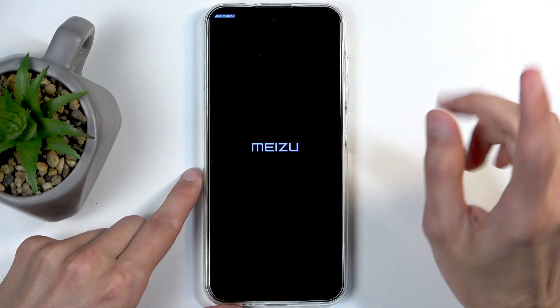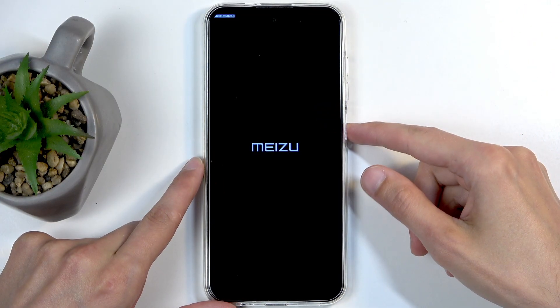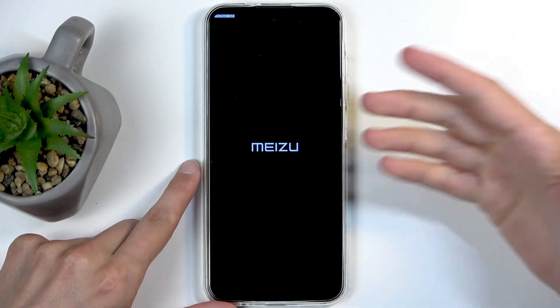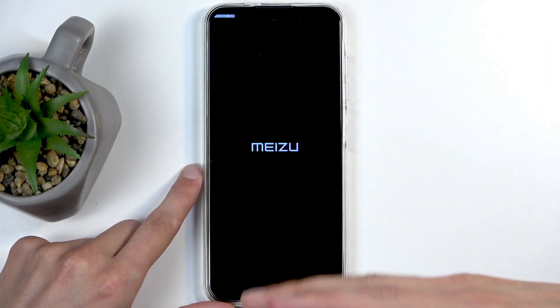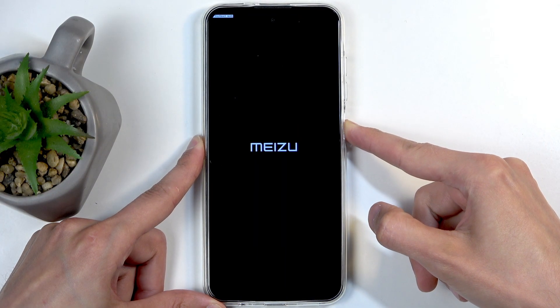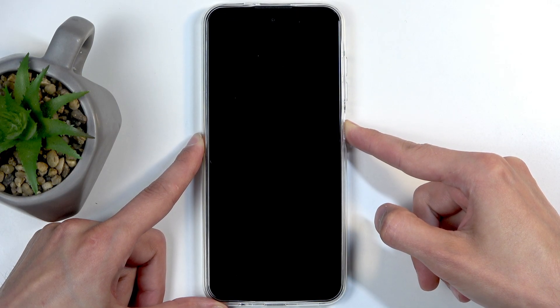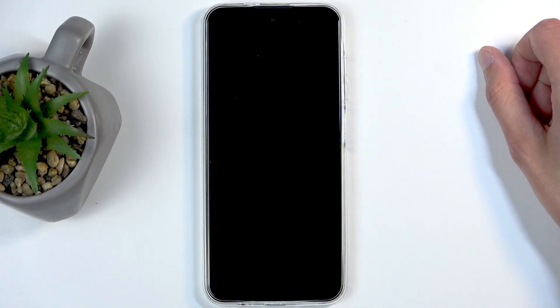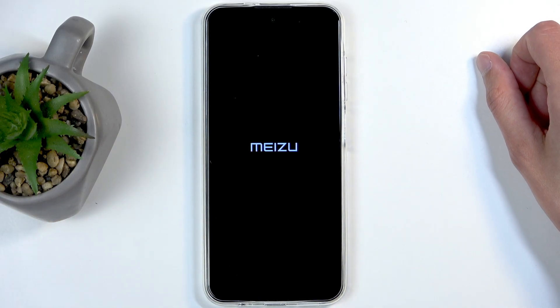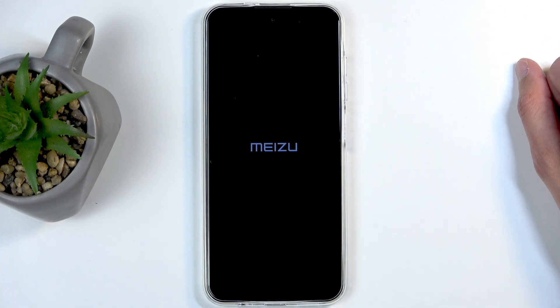I also want to point out there is no recovery mode, if you're wondering. Now to leave this mode, you can either use an application — because it's usually what you use fastboot for through your connection to the computer — or you can just hold your power button till the screen turns off. Once it disappears, the device will start booting up on its own, as you can see, and this will now boot us back into Android.